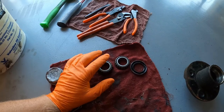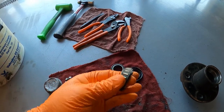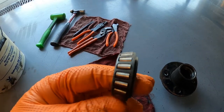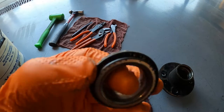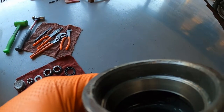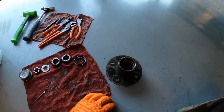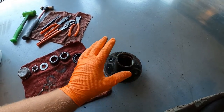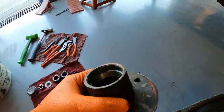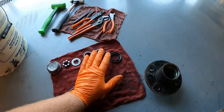We've gone through and cleaned everything up. The way we cleaned them was just using some brake clean with a little nozzle end, sprayed these out - they don't need a ton. At this point we go through and inspect them: inspect all the rollers, make sure there's no nicks, and look for any dark coloration that would indicate they've gotten too hot. These bearings had plenty of grease in them and there was really nothing out of the ordinary. We're going to look at the inner bearing races - they were a little dark, more than likely because there was a bit too much preload on these; they were kind of tough to turn. The coloring on the outer races is equal though, there's no pitting, no brinelling, nothing flaking off, so they're more than likely going to be all right. I wouldn't be surprised if these were the original bearings from 1973.